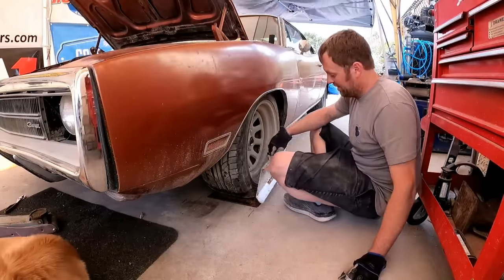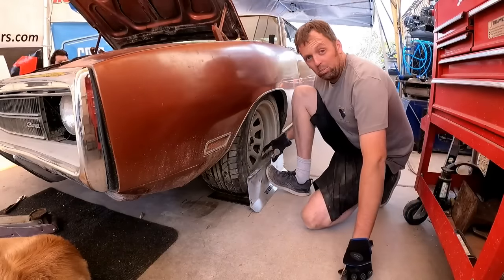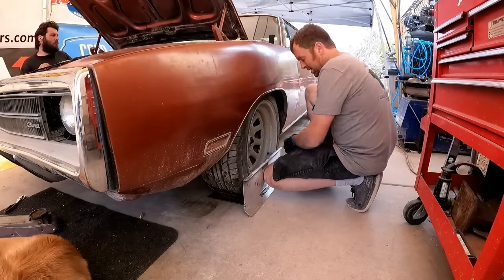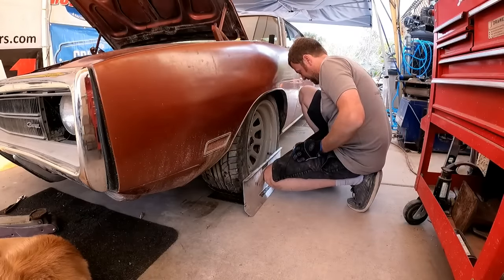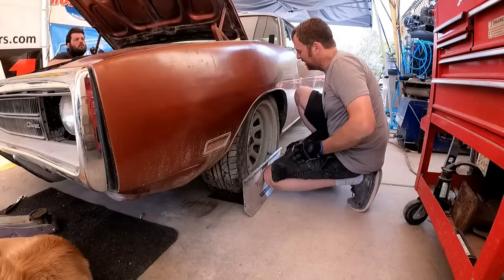Now just for shits and giggles, we're gonna go ahead and check the toe with my toe plate, see how close I am. Am I actually the 1/16 of an inch like I thought? So, Derek's got a toe plate on the other side. This is what I normally do. I normally just push on the plate with my knee, and then you slip up the tape measure. I'll slide it on the back side. Derek will hook it to his plate. Got it? There. So I have 72 7/16, it looks like. All right, let go.